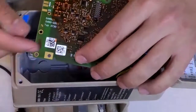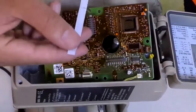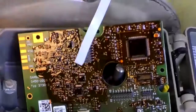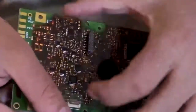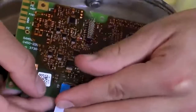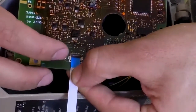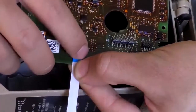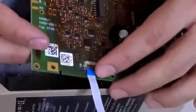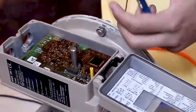I raise the protector. As you can see, the blue object on this end of the FFC cable has fallen. Be careful when you want to connect the FFC cable — this blue object must be attached to the cable, because without it the connectors do not hold the cable. I must attach the blue piece to this end and then connect it. I try to connect the cables as straight as possible — it must be vertical and connected to the connector completely. After that I press the protector on it until I hear it is closed, which means the cable is totally tightened.